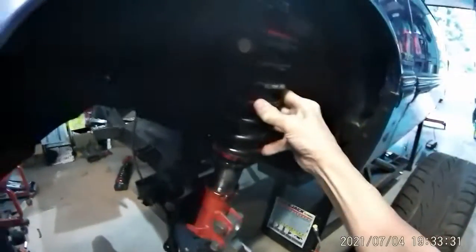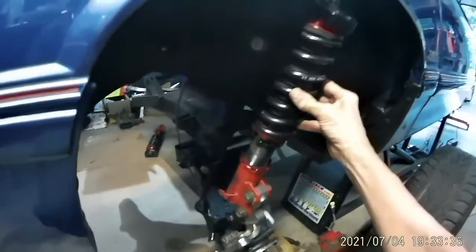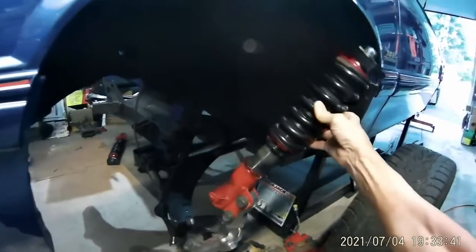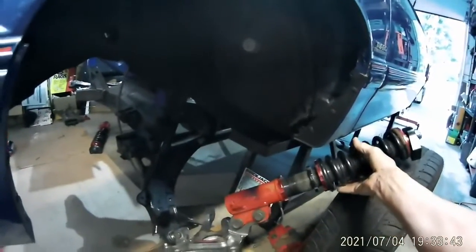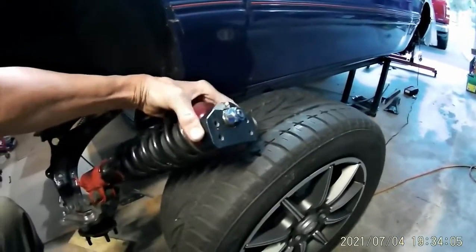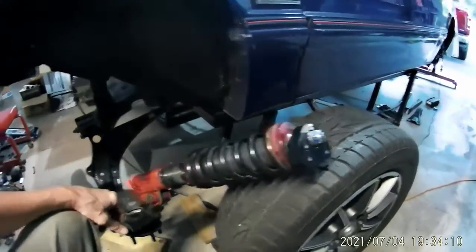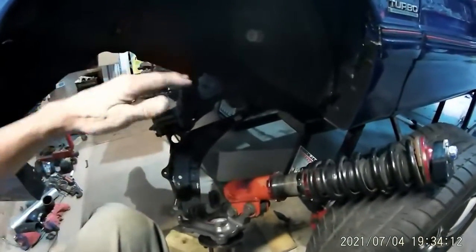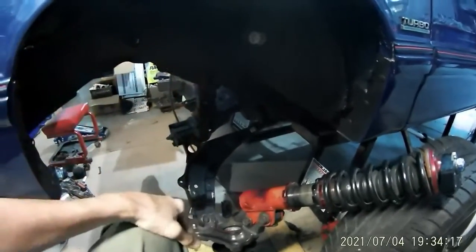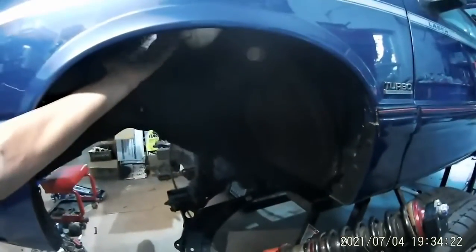This is the strut that I got from Megan Racing for a VW Golf. I like Rich Bryant's Neon SRT setup much better, but I had this before he had his. So this uses a different hat on top. This has been machined because I had another interference issue years ago. I set this up so that the tire has full rise before it bottoms out any more vertical, and it would be rubbing on the inside of the fender.